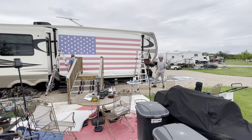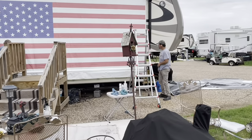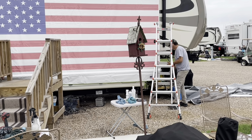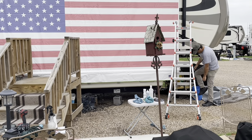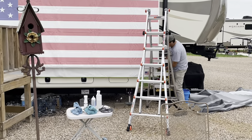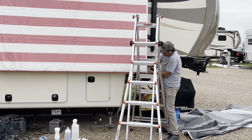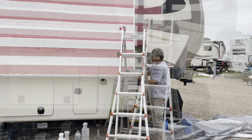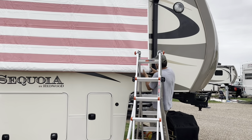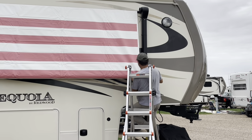Now we're going to do everything opposite of what we did before. We've got the tube and the valance all situated, so Leighton and I are carefully going to start rolling this up. As you're rolling it, pull it away from the wall so you don't do any damage. Make sure you're tracking kind of straight — let it hang with the weight of the tube and fabric to pull the wrinkles out as you go.